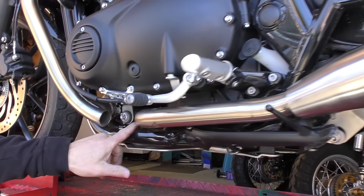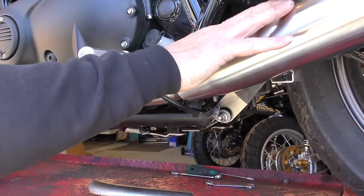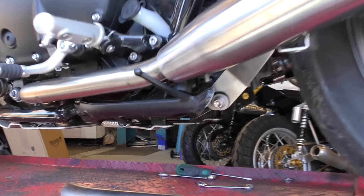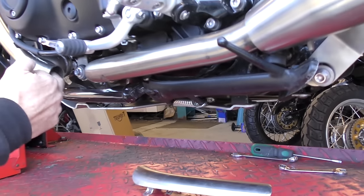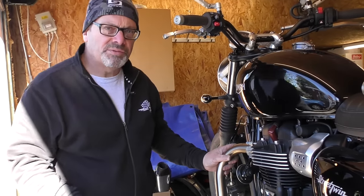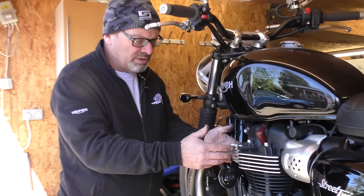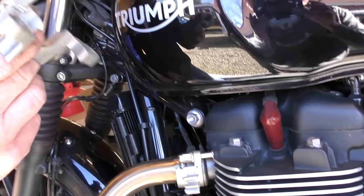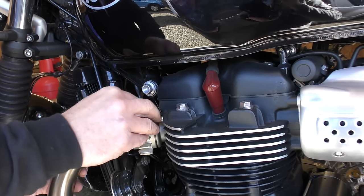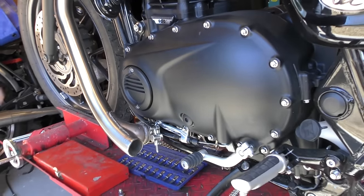You can see there are a couple of clamps in here. Just loosen those off with a socket, loosen the silencer at the back, and there's also a separate mounting on each side at the middle. Once you've taken those off you can take the back part of the exhaust system off. A little shortcut I've found: when you loosen the front pipes off, just loosen them — don't take them completely off. Remove the clamp part that goes around the lambda sensor and slip the bottom part back on again. It keeps the pipe in place, saves you having to disconnect the lambda sensor, and the pipe just hangs there out of the way. Do that both sides and it saves a bit of mess.